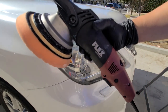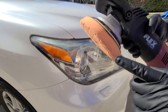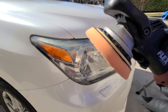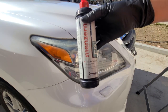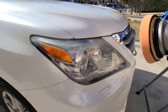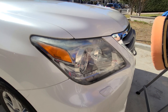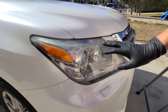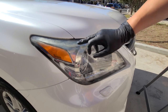This is a dual action polisher from Flex, a very top quality product. I've had it for years. I'm using an orange pad here, which is abrasive but not so abrasive that it can do damage to your paint or plastic. And I'm going to be using a compound by Menzerna. They changed the name a little bit, but I'll put the link in the description. Also, this is just a bottle I filled with alcohol and water, called IPA mix. First thing, if you haven't done it, clean this off. Generally you can tape the area, but now I'm just going to apply the product and see if I can get this cleared out.